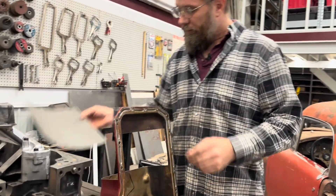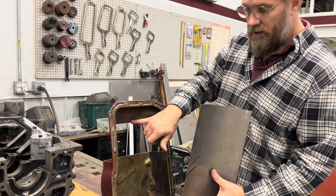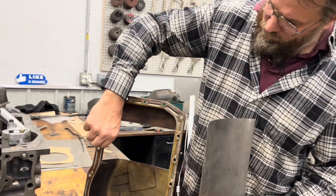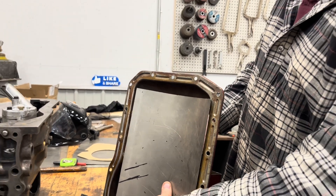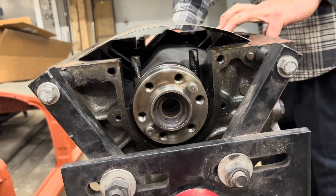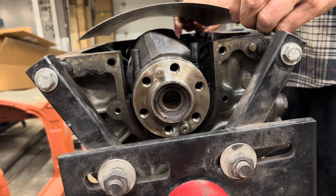The next thing to figure out is how high within the pan this wants to actually be. I want it a little bit above this so that oil can drain back — that would put it roughly a half inch down from here. Some people might think that's awful close to the crank, but let me show you on this other engine. Here I've got the windage tray all the way against the block and there's plenty of room for clearance for the crank and rods. So I'm going to be another half inch off the block.